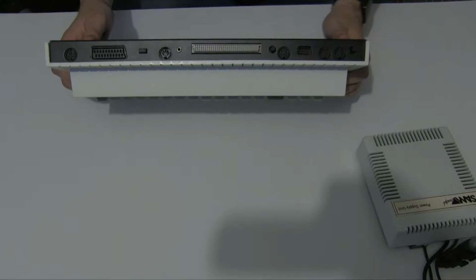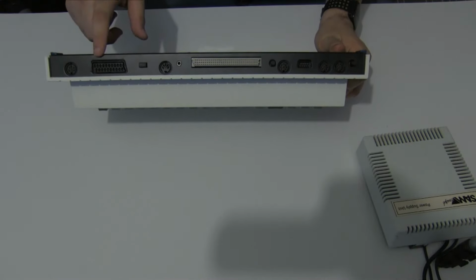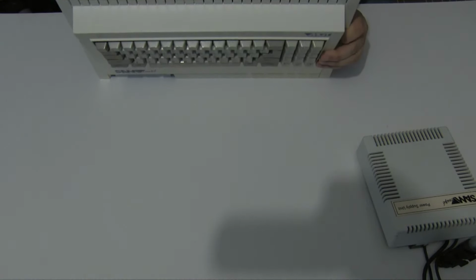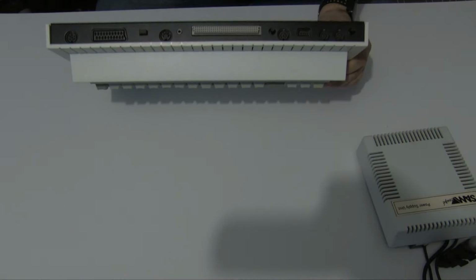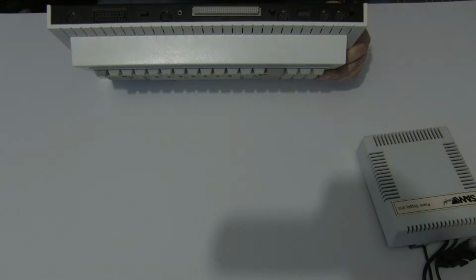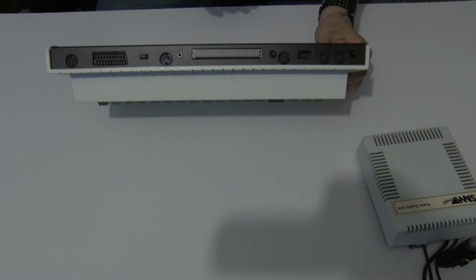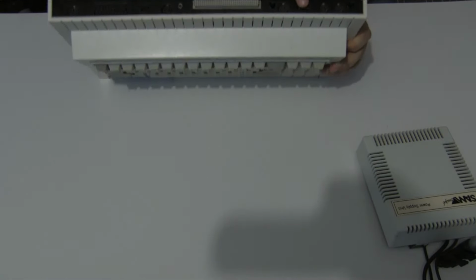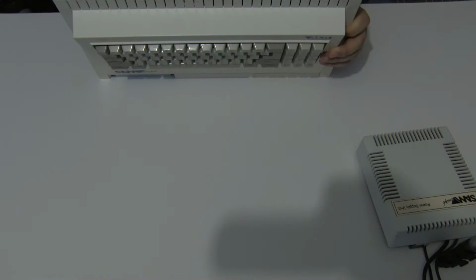back has several ports. So we've got a SCART port here, although it's not standard SCART. It's got a special kind of wiring, so you have to get the proper cable. The power DIN, we'll talk about the power supply in a minute. That's got another bit of useful information for it. There's this, which is the power button. There's an audio socket here because this could also load from tape. The disk drives weren't standard, but well, eventually they were, but to begin with they weren't. This little add-on, peripheral add-on plug-in, slightly better version of it than the Spectrum did, which is its bare edge connector. Then we have a reset button, joystick port, and over here we've got an NMI button which lets you break into programs. There's some MIDI ports as well and bits like that, and monitors.